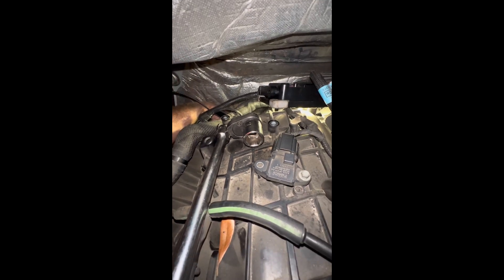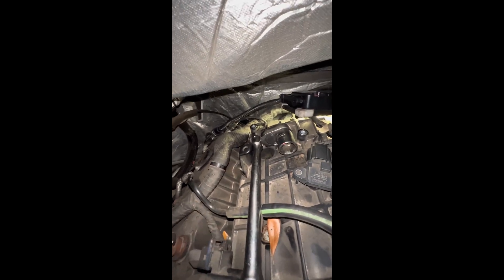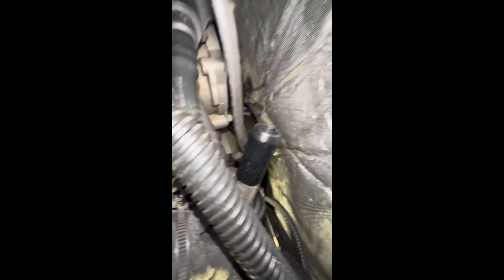See if I can grab the clip just to have an extra one. Okay, so with the 18mm shallow and busting here — I got the fitting out and it fell on the ground. So you can take the heater hose off right there, tuck it right there, and you have basically a straight shot. You can see the fitting — just push out of the way. It actually threads in right there, so I got the old one out. Hopefully it'll fall out and I'll get the new one ready.